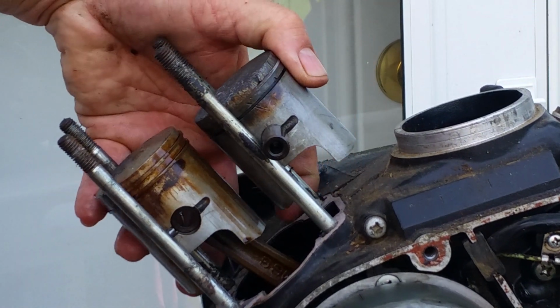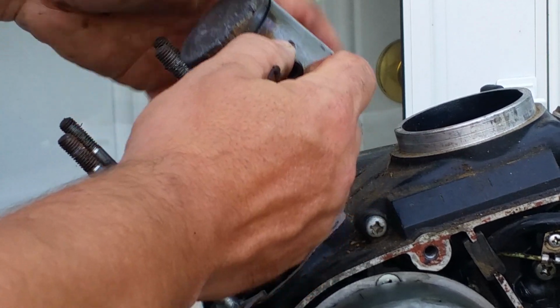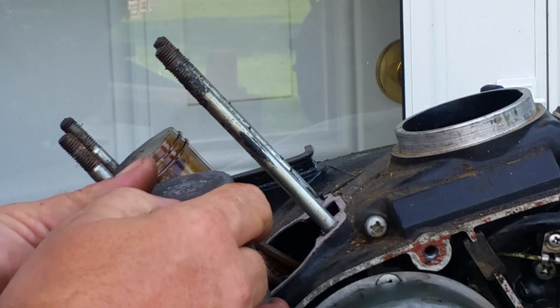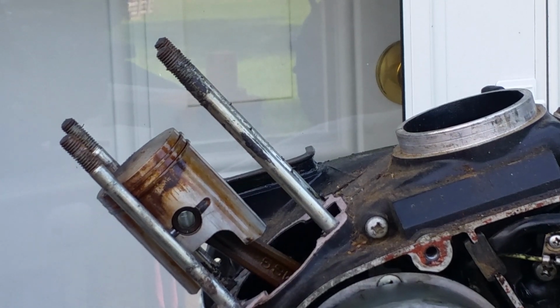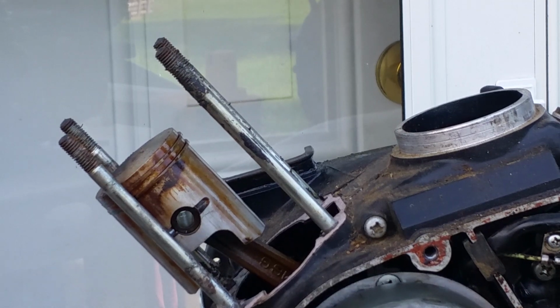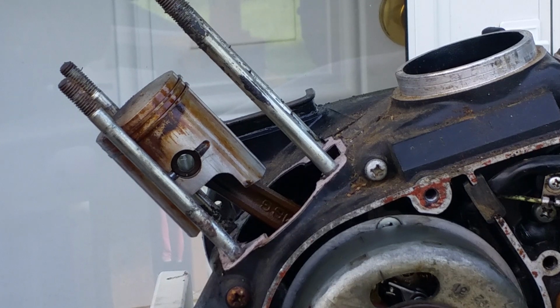They are literally different heights. And the wrist pins, I can't even pull this one out to show you, but the wrist pin is totally different in diameter. So they're not interchangeable, which kind of sucks, because that'd be really cool to be able to put a G4 cylinder jug onto a G5, but with anything else, evolution happens, and they did it for a reason.